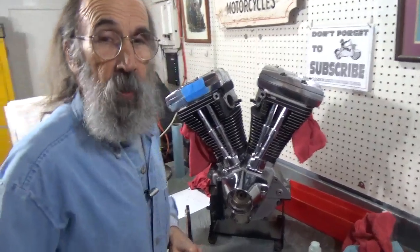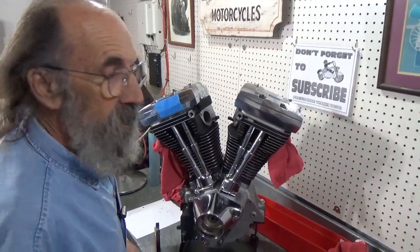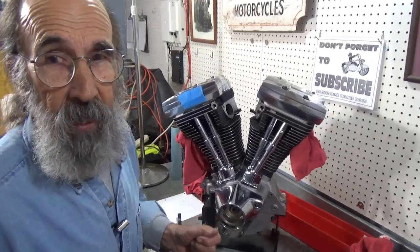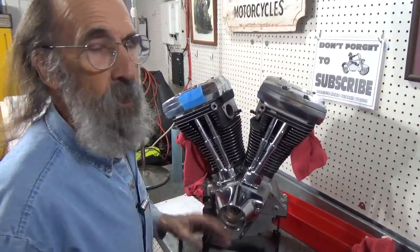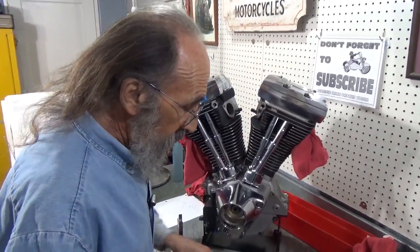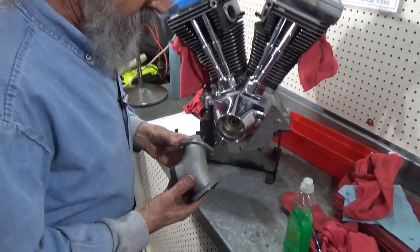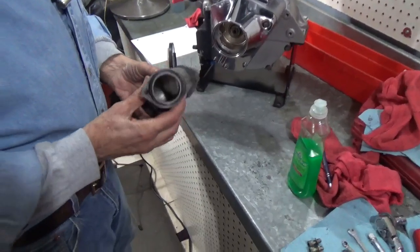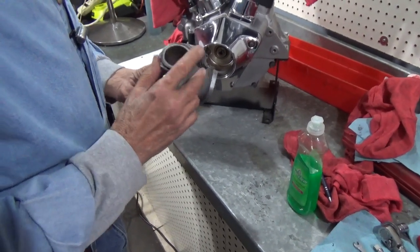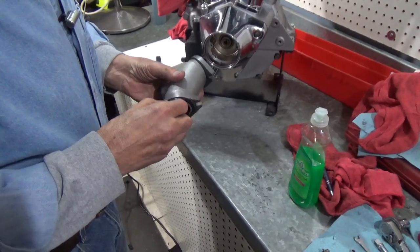The worst part, of course, is you'll get a vacuum leak. It's easy to tell if you have a vacuum leak. You pull out your spark plugs, you got a dark one and a light one. Believe me, you've got a vacuum leak. 99.9% of the time, it's a leak at the intake manifold. So I'm going to take this seriously, as I normally do, and hopefully that'll help somebody from the pitfalls that do occur. Okay. First off, the new seals are in place.